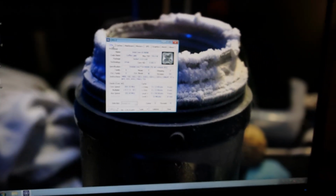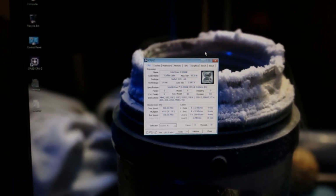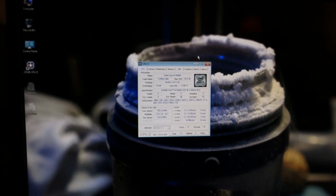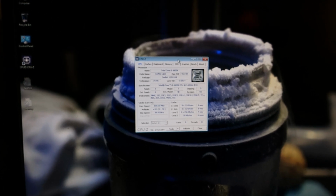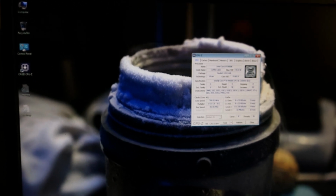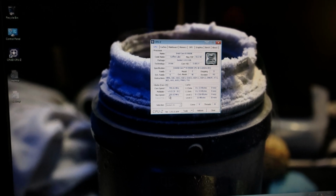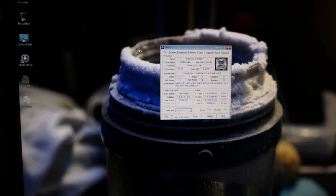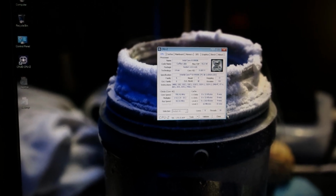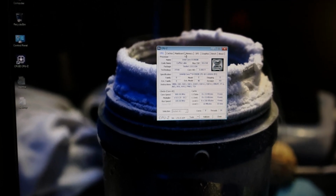So yeah, that's how you install Windows 7 from a USB stick on any modern platform like Z370, Z390, X299, even C621 if the board has PS/2 or completely functioning PS/2 emulation. So there's no PS/2 emulation right now on the SR3 Dark. I will ask about it, and when it's implemented correctly, you can install Windows 7 just fine, even with the 28-core Xeon. So yeah, that's pretty much it.